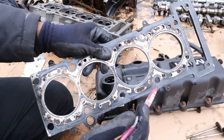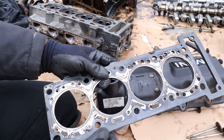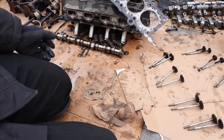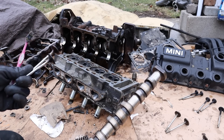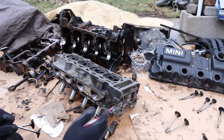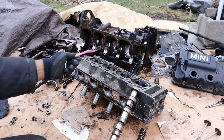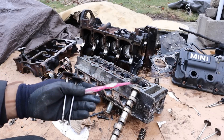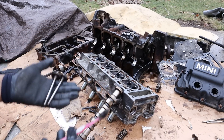Furthermore, if the compression mixes with the coolant jacket, that would cause it to burn a lot of coolant with white smoke coming out of the tailpipe. I'm kind of ruling that out in this case because this isn't really a Subaru after all. And that's a look inside of the Mini Tri-Tech engine. This engine was co-developed with Chrysler, and I think that's why this engine is actually pretty simple and doesn't have too many quirky design cues — with the exception of not having a proper timing cover for easy access. While this engine is definitely solidly built and you could throw a lot more power at it, I think it's going to need a lot more maintenance and repairs than a typical subcompact cheap-and-cheerful vehicle. Make sure you subscribe if you want to see more videos like this one.